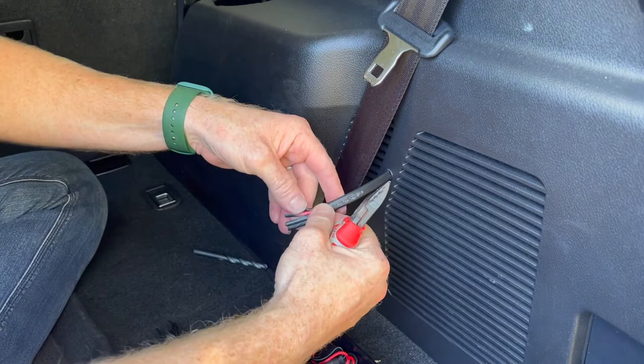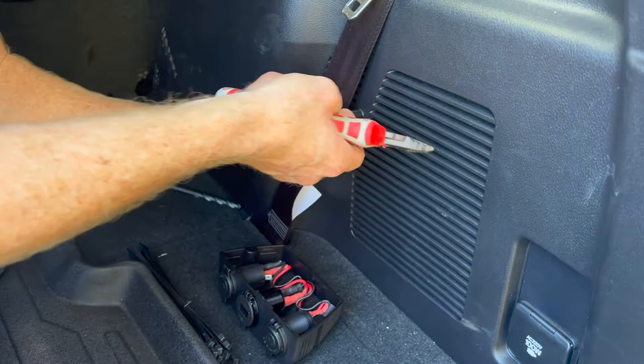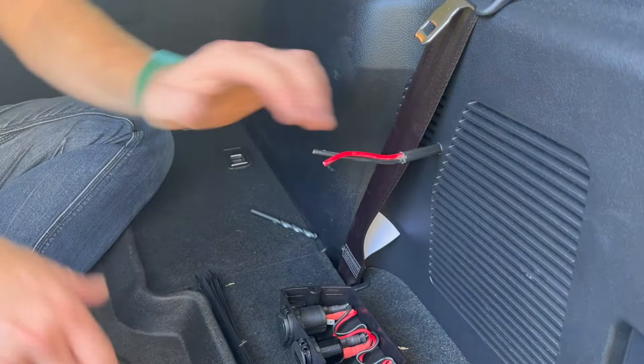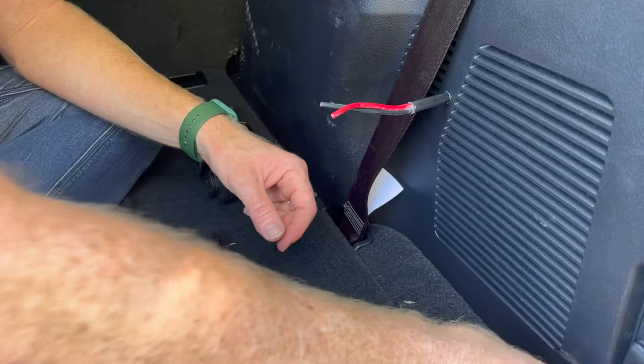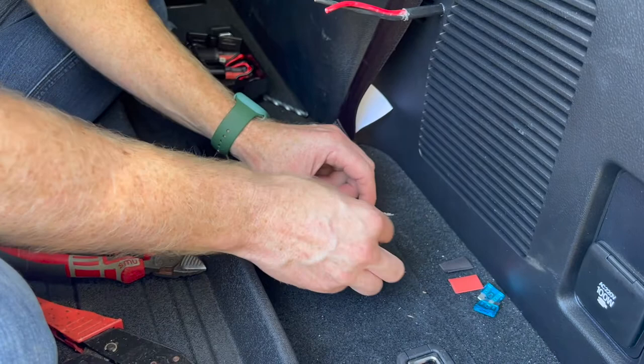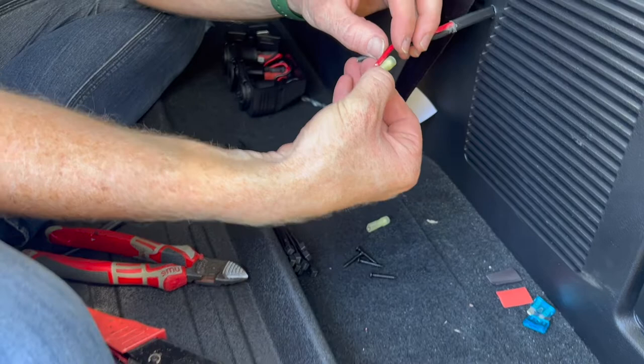All of this will be hidden away behind the little socket tent. I'm just going to fully remove that outer insulation. In our pack of accessories we've got our fuses, a couple pieces of heat shrink, and two yellow terminals. Strip enough cable so it goes into the cylinder inside the terminal — that's how much to strip off. Just use a pair of cutters with a light squeeze to cut through the rubber and strip that much off.